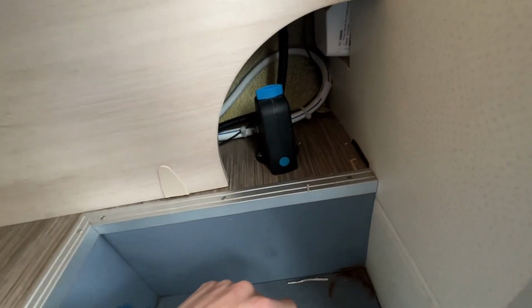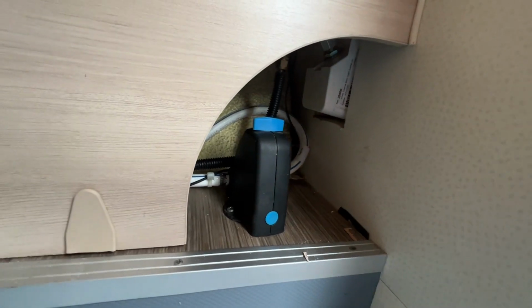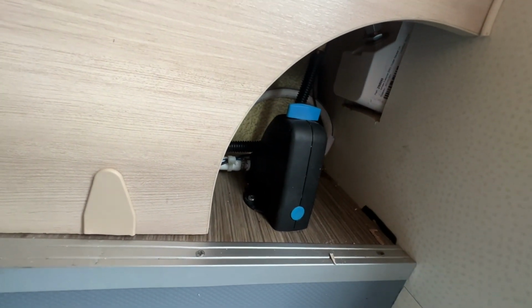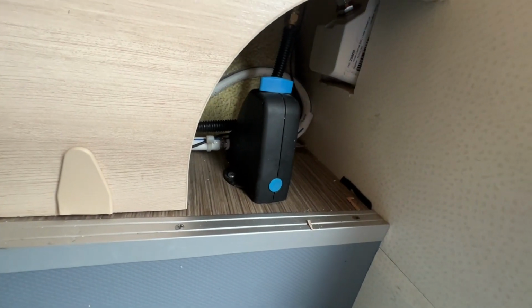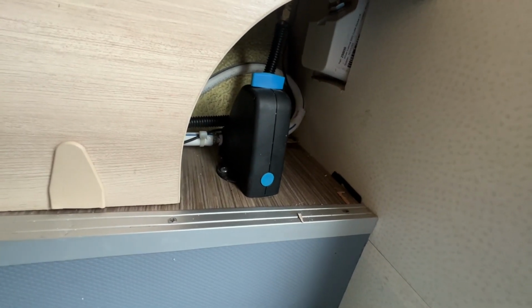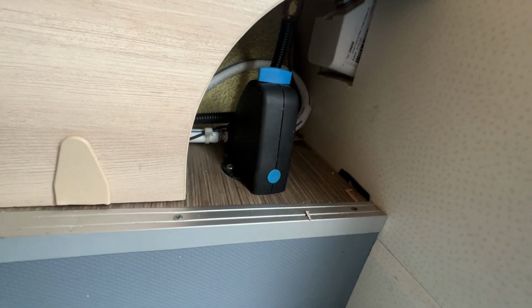this is your boiler drain, this here. So you've got the vent on the outside of the van, gives a location of where the boiler is situated on board. To open it up and allow the water out in the winter, which is very important because you don't want the water to freeze, because if the water did freeze in the boiler, unfortunately, because it's your responsibility to drain the vehicle down, frost damage isn't covered by the warranty company.